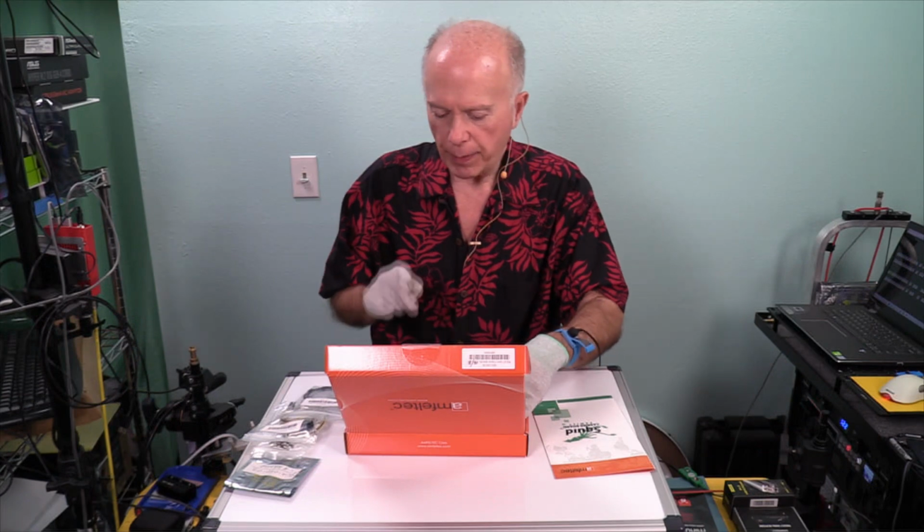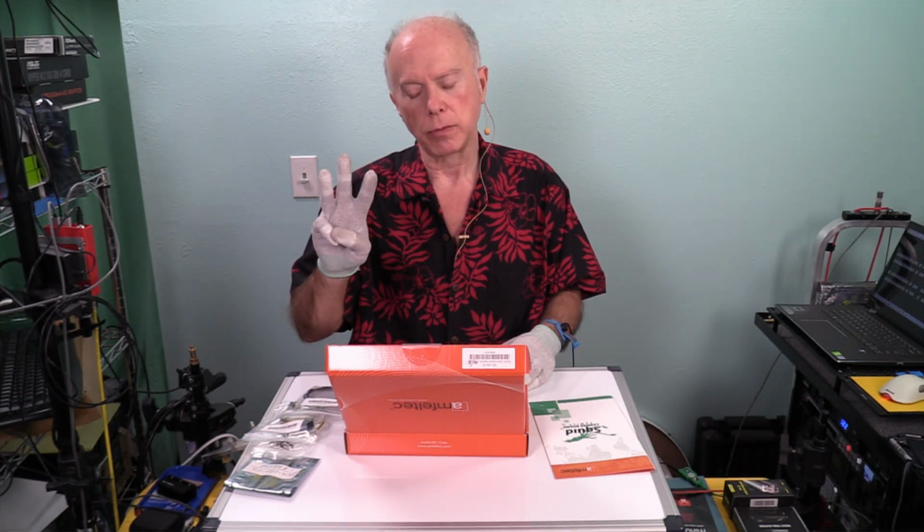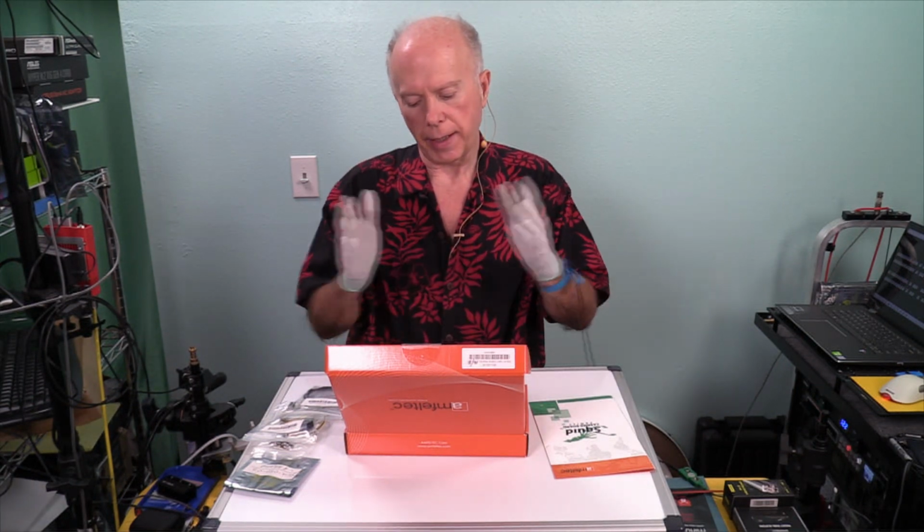And while we're on that topic of heat sinks, remember, this is PCI Express 3.0. So of the three things that can define the speed of one of these, meaning an add-in card, which happens to have 6 drives. And remember, each M.2 NVMe drive requires 4 lanes. So 4 lanes per drive, 4 times 4, that's 16 lanes. So we're going to take 16 lanes with an uplink and a downlink through the PLX chip, manage 6 drives, because this has a Broadcom chip.